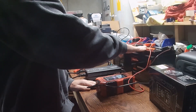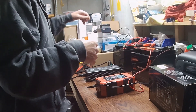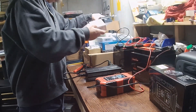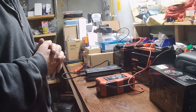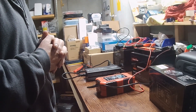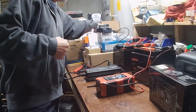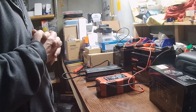I've also charged mine with a small solar setup up in New Hampshire. That setup works great because I have some Renogy 10-amp Wanderer solar controllers, and I'm able to easily change the mode between lead-acid, AGM, or lithium batteries. I'm just using one 100-watt solar panel, and it allows me to keep my trolling motor batteries charged at all times. I can even throw a power inverter on the solar setup to charge my Ryobi batteries outside in the enclosure.